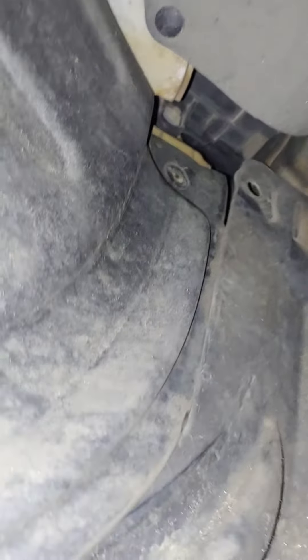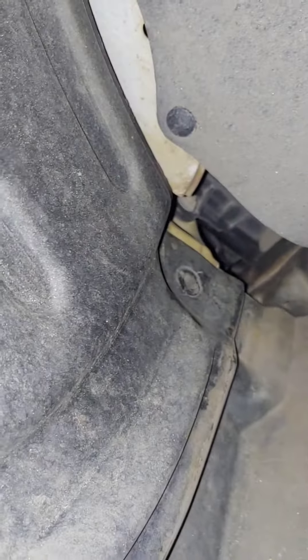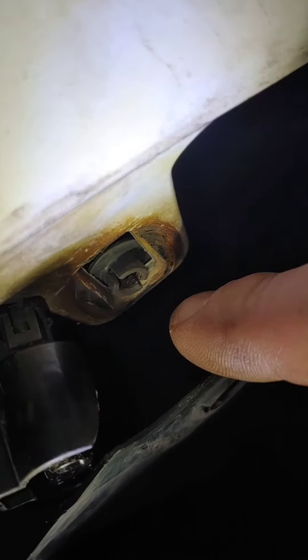And then there was one more back here. When this falls, it goes up behind there, and then when it falls it goes in front of it. I still noticed this one was the problem. So when I was tinkering with these clips, I took those off. I had trouble with this one and had to reach up in here with some skinny vice grips and pinch the little nut, because it was spinning — it was unseated from the housing in here. So it was spinning around, but I finally got it off.